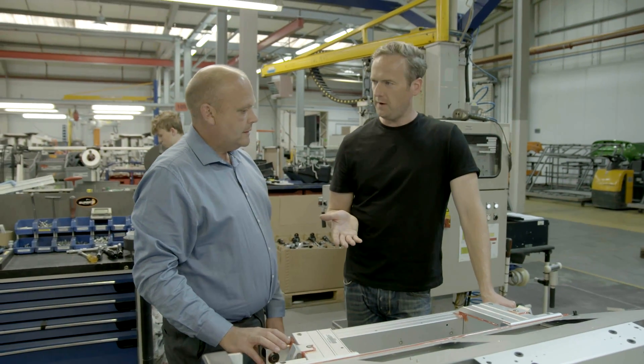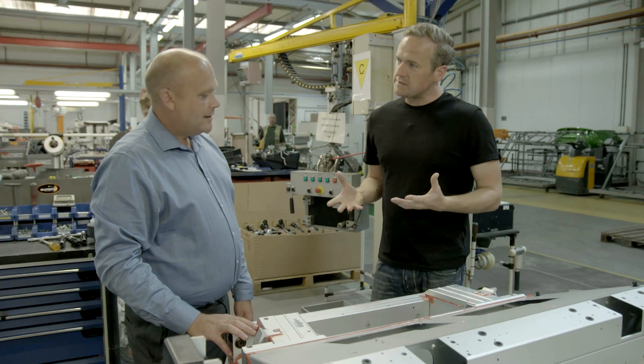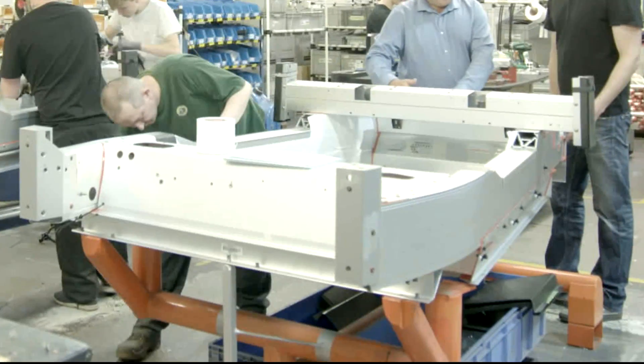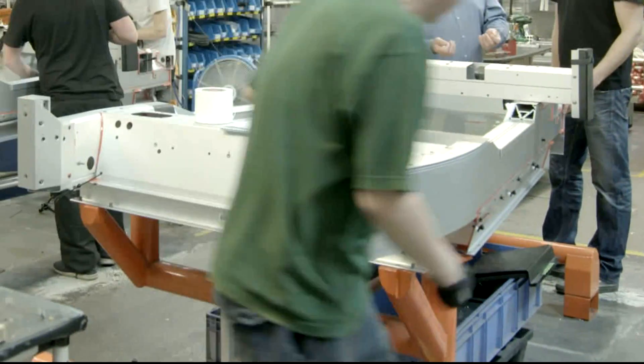It's interesting you've opted for bonding. Trains and carriages are glued together, aeroplanes are now glued together — aeroplane wings. When you see the amount of stretch they can have and the loads going through, our chassis takes all those same loads. And we're not adding weight and complexity. It's a lot easier — you'd need qualified, complicated TIG welders for welding. This chassis is symmetrical down the centre, so at this stage it's not been decided whether it's right or left-hand drive.